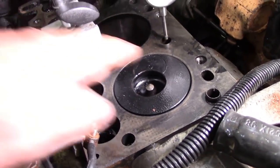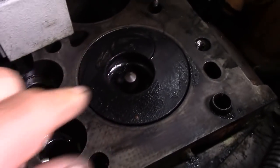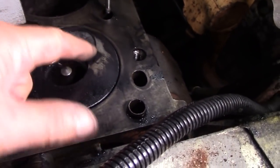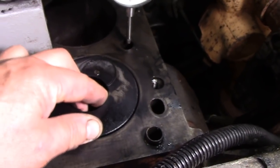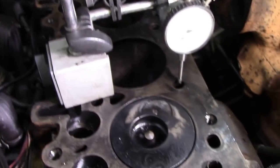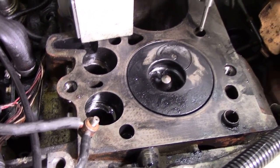So let me put the magnet back on. But one thing I noticed is this here. Look how the valve's been hitting here, look. Wait a minute, let me get a bit of paper, I'll clean it up a bit. There you go, look at that. There's a great big mark in it. Holy shit, that's bad, isn't it? Look how it plays on that piston. Look at it. Still, needs a rebore, but who cares? It's a tired engine. Well, he just wants the head replacing, and that is it.